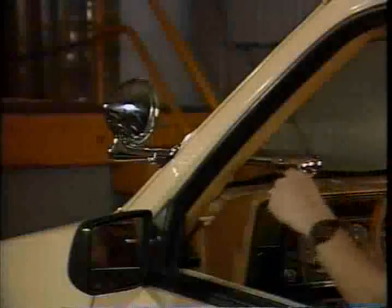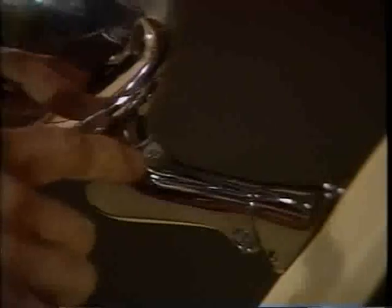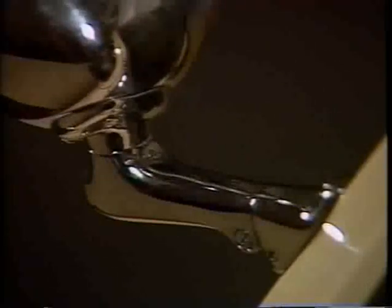Finally, test the light by turning the light on. Rotate it up and down and around, making sure it doesn't blink or flash. It's easy to make adjustments after installation. The head housing clamping screw controls the vertical adjustment, while the set screw at the top of the housing controls the horizontal tension. Be sure not to over-tighten, which can force the handle to slip. The tension should be sufficient to hold the position of the spotlight in the wind at highway speeds.